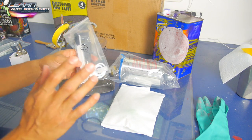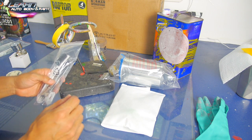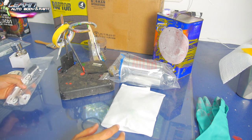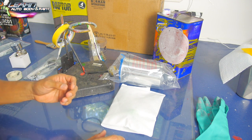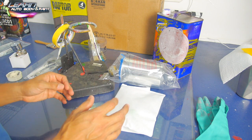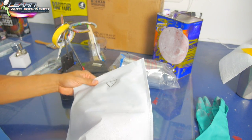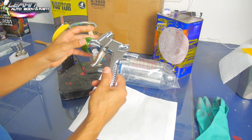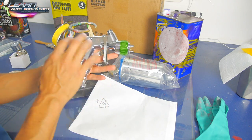It's not recommended to mess with a brand new spray gun in the beginning unless you have a small paint leakage. This sometimes happens because guns are made and sitting in warehouses, shipped in containers where it can get over 100 degrees. The Atom spray guns are a no O-ring design, but some plastic seals inside can get warped, so it's really not recommended to completely disassemble a brand new spray gun when you get it.